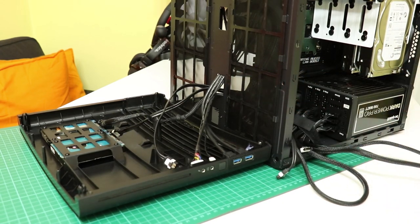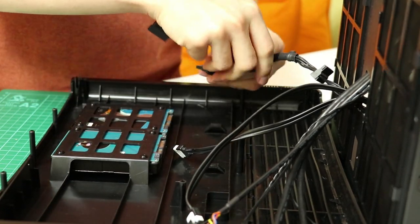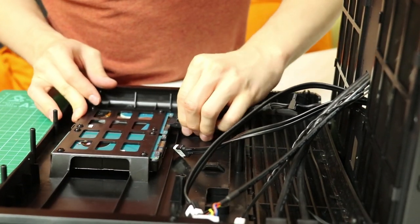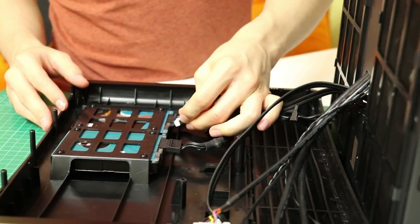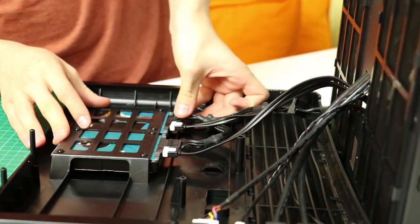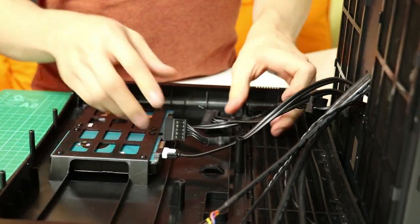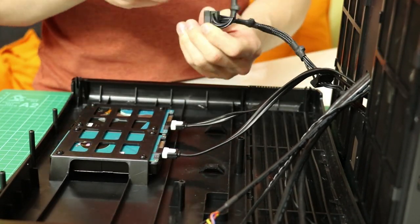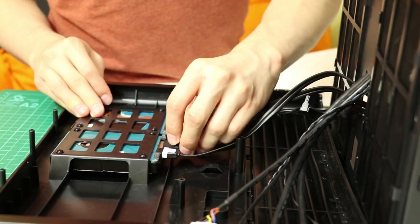Routing the power and SATA data cables wasn't really an issue. I'm okay with a tight approach like this if it's designed well. However, it's worth pointing out that depending on the power cables you have, this approach can go a couple of different ways. For me, the intermediate power connectors have side connecting cables, which is an awkward connection in tight spaces. So it's worth having the intermediate connector further in where there is more room due to the bow of the panel, and have the end connector further out where there is less room.